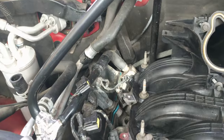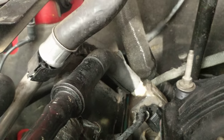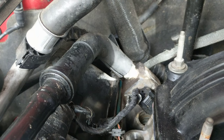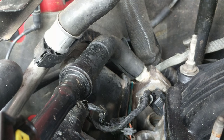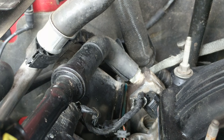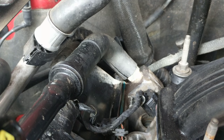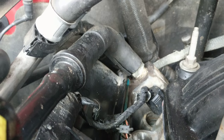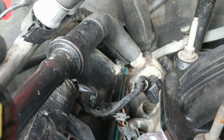I just wanted to point something out real quick as I was putting the intake back on. If you look at where that hose is split — you can see this is what I was talking about. I've been moving these things all around and sure enough that hose is split. That showed much earlier in the video — a split in the other hose too. Just some things to pay attention to. All of these engines run on vacuums, which controls a lot of other things. So just keep an eye out. Things like this can be repaired — you can either get new hoses or you can wrap them.